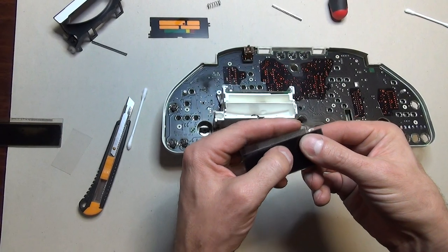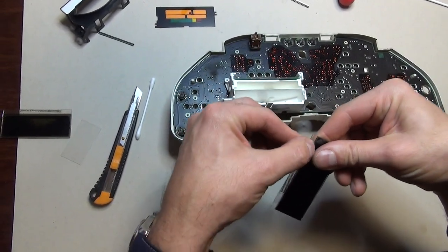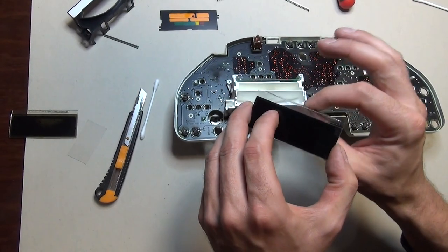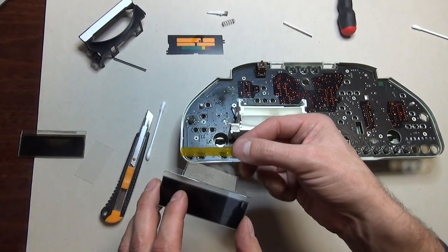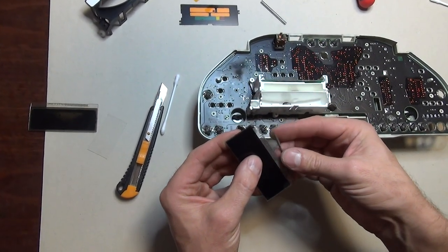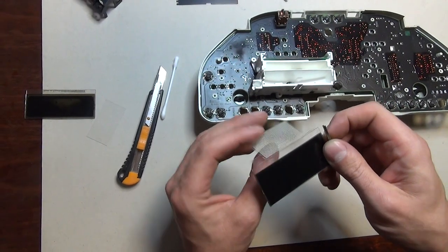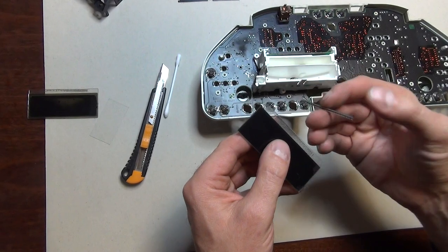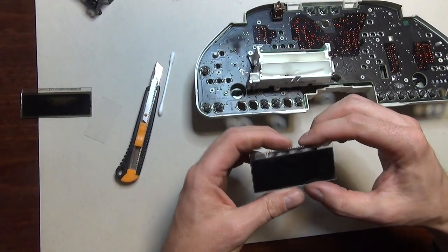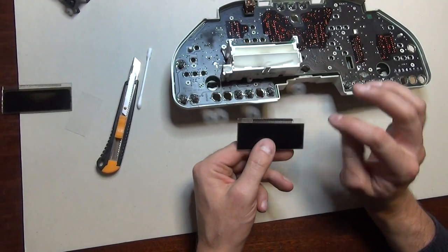I just found it and I turn over the tape. The purpose of this whole thing is that I'm going to try to fix the cable in the right position — it's not about connecting these two things yet, it's just about finding the right position. It was done with an orange tape originally in the factory. I'm going to put back the original snap-on clips. The position is LCD with the cables facing down, and I snap the clip back just like this. The pressure provided by this clip is enough to have a proper connection between the display and the cable.